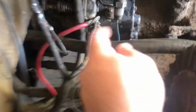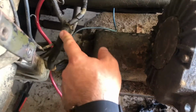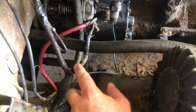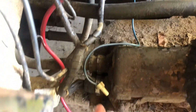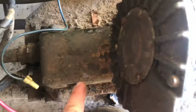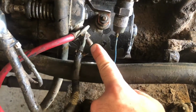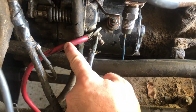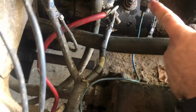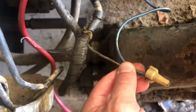One, this wiring harness in this Jeep, honestly, it's been hacked up over the years from it being in the military and then private use and all that stuff. I was missing this wire right here, which runs from the regulator on the frame here to the wiring harness, and it actually bolts up to the starter solenoid on the positive side. Then you've got your positive side of your battery for your 24 volts. Then you've got your trigger wire for your distributor, which actually goes into the same harness right here.